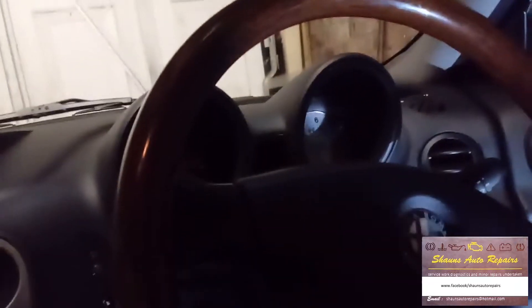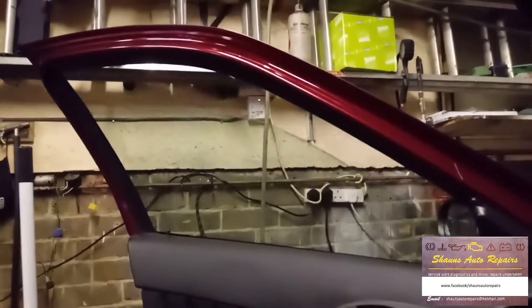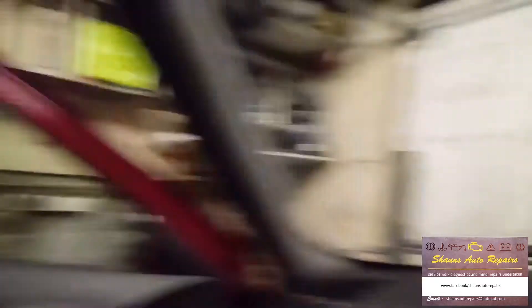First of all, let's put the ignition on. From the driver's door panel we get four electric window switches. The driver's window works okay. The near-side rear window makes a little clunking sound going up and clunking sound going down. The driver's side rear does nothing at all.